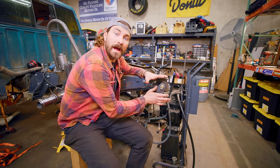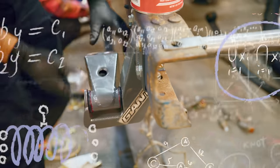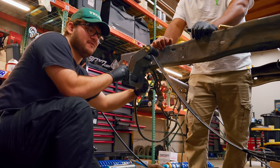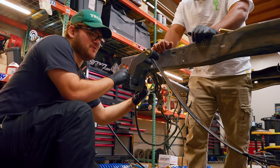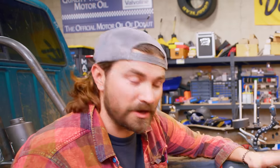Here at the back, we've got our giant inverted shackle. Normally you'd have to do a lot of math to figure out what length this shackle should be — that affects your spring rate, general ride, and spring travel. But luckily, we bought a kit that goes into the factory mounting points and has all the math figured out for us. So all we had to do was bolt it right up.